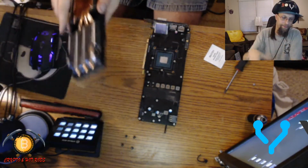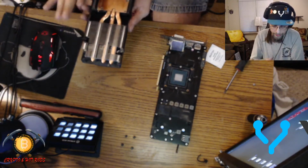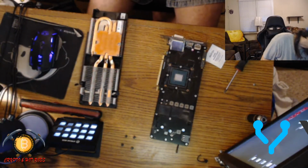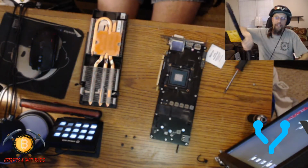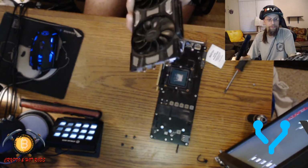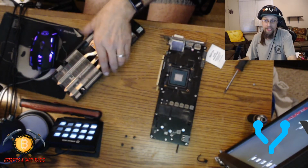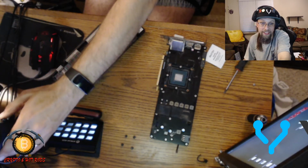That's gone. So the next step that I'm going to do on the cooler side is I'm going to blow out the rest of the dust bunnies in here. So I've got a little shop vac, well, not a shop vac, a little canister vac for that, and I'm going to turn it on. And then remember to hold on to the fans. Don't let them spool up, guys. It will grind your fans to a halt. So give me 1 second.